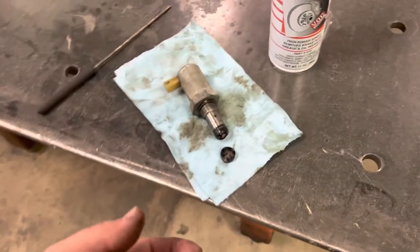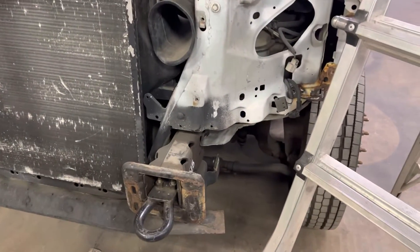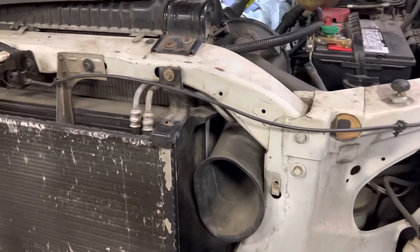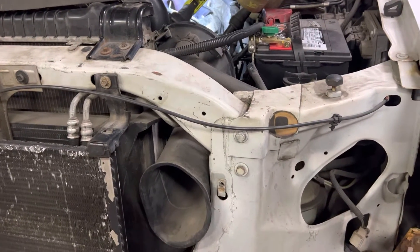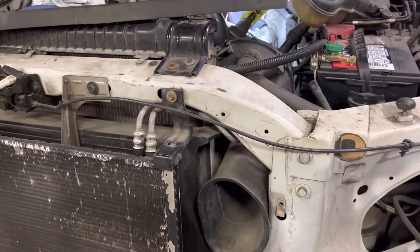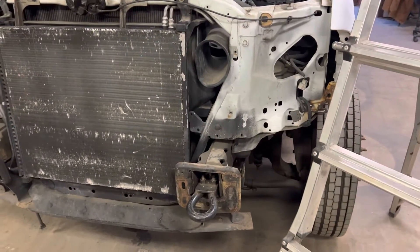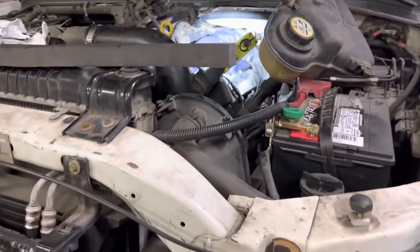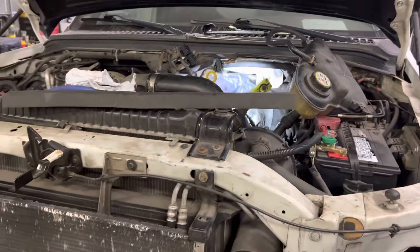I fished that out and got everything cleaned up. I'd also been wondering why this has been running with sort of a rough idle — not too bad, it would start without issues, but it just didn't seem like it was running right, like maybe an injector was bad. Now we're going to find out once it's all back together. There could be a stuck injector — it was sitting three years before I bought it, and I've been starting it frequently over the last 10 months during the rebuild. I just installed the new IPR valve and I'm going to put everything back together.